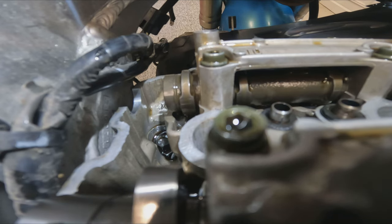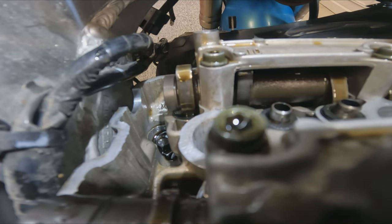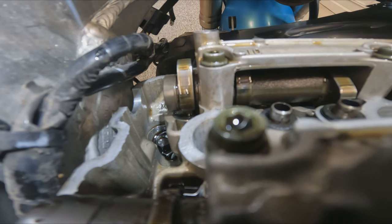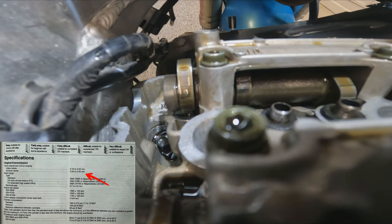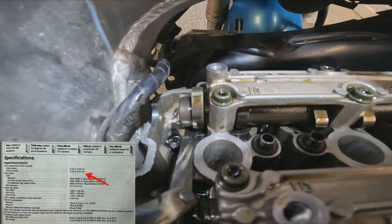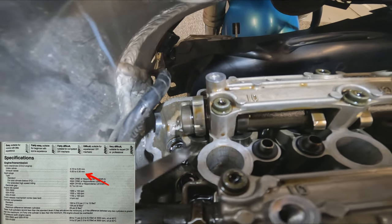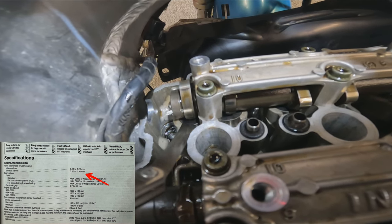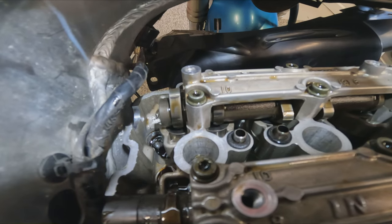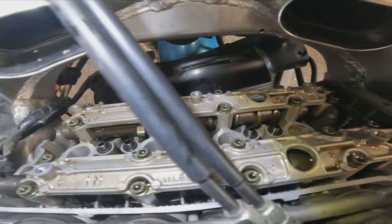Let's give one more example on the exhaust camshaft. We can see the cam lobes just coming up, and there we have it in the correct position to check the clearance. Remembering that this is the exhaust valve, we're now going between 0.2 and 0.3 of a millimetre. The 0.2 blade slips between the heel of the cam and the follower with a little bit of resistance — just right. The 0.3 won't go in, which is correct. So the tolerance in that gap is between 0.2 and 0.3 of a millimetre. Go along checking all your clearances, and if they're all within specification, no further action is needed.